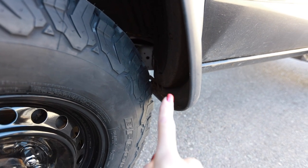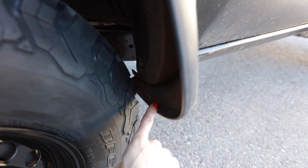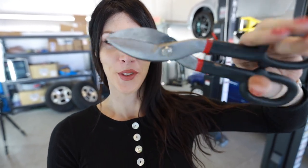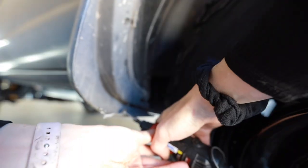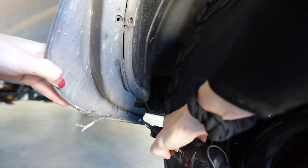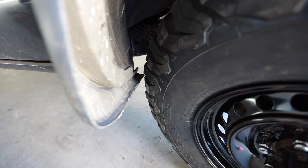Slight dilemma. I did read that this was a possibility with the size tire, and yep it is definitely possible. I have to trim the bottom of the mud guard just a little bit because it's rubbing on the tire at full lock. What's even weirder about it is it only does it on the driver's side — I don't understand why. I guess the passenger side one is worn more than the driver's side one, so I'll just trim it a little bit. Oh, these scissors suck — I thought these scissors would work. These are terrible. There, I think that'll work good. I just gotta clean it up so it doesn't look so ratty.